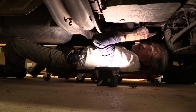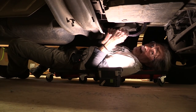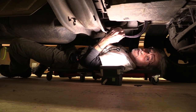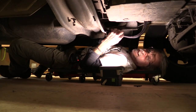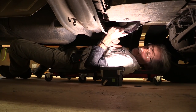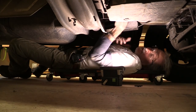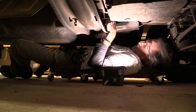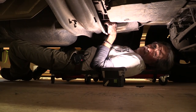Devin's doing the tricky part up there, hooking up the panel for the battery and the breakers. I've got the job of running the wires back to where the solar kit's going to live. I wrapped both of them — there are two pretty good-sized cables that Devin had me wrap with that nylon stuff that protects them. Everything under here is wrapped with the same stuff so it's not exposed. I'm feeding it over the top of every cross beam I can, using wire ties to keep it up near the top with the rest of the wire, and then running it right up through the hole I drilled in the back of the truck. A couple more wire ties and I'll be done.